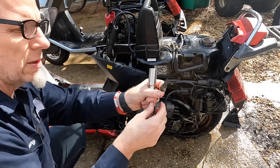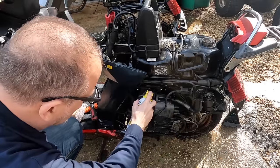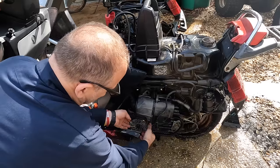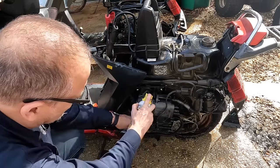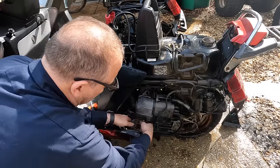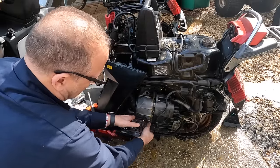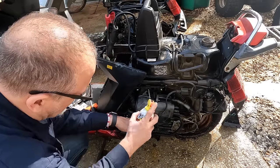It's a little rich but we've got the spark plug out. Let's see if we can put some juice in here and see if this sucker turns over. Yeah — it actually turns over! I was curious whether it was just spinning on the flywheel or if it was stripped, but it's not — it shoots stuff out, which means it's got some kind of compression. I don't know if it's got enough, but we'll find out.